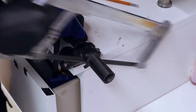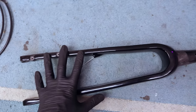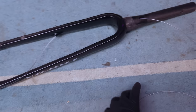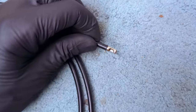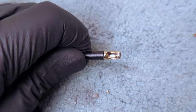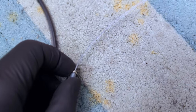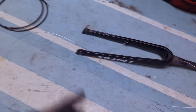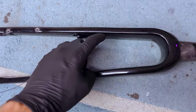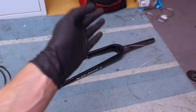With that cut I can now run the brake hoses through the fork and the frame. I've got a gear cable and I'll show you what it's for — these brake hoses attached to the calipers have a little metal piece on the end. A gear cable fits quite nicely into a little recess in that metal piece, basically enabling you to pull the brake hoses through tough to reach places. I've fed the gear cable through and I can pull that through and fit up the brake hose — a good little hack.